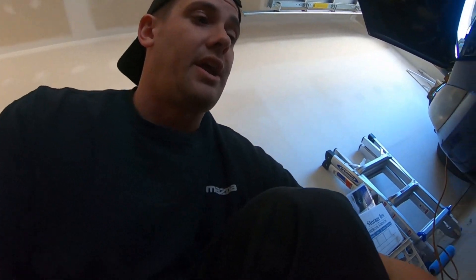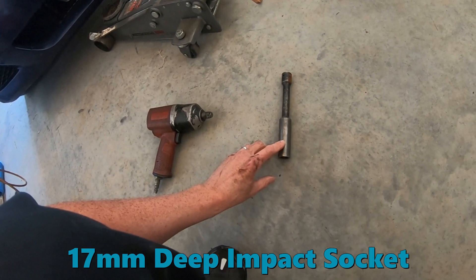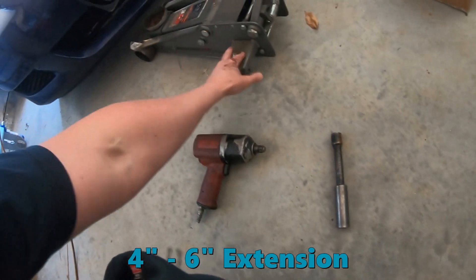In order to get the engine mount out of the car I'm only going to use four tools: a half inch impact gun, a 17 millimeter half inch drive impact socket, a small extension, and a floor jack. We need to support the engine from the bottom so that when we take out this engine mount the engine doesn't fall in or sag the other engine mounts really badly. To do that we're going to roll the floor jack underneath the AC compressor and hit towards the back side of the compressor.